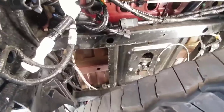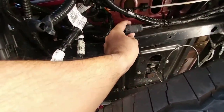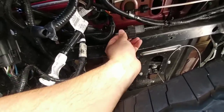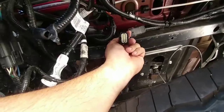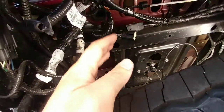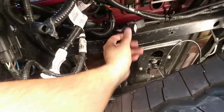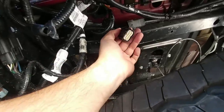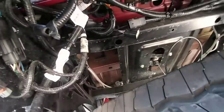With the spare tire up, I found out there's a little piece that is essentially a cap — it doesn't connect to anything. The plug you need plugs into that cap just to keep dust, dirt, and debris out when you're not using the camera. So once you unplug it from the cap, you have full access to it. Keep in mind you have to remove the factory plug from this cap on the wiring harness, and then it will plug directly into the camera connection cord that comes with the new camera.